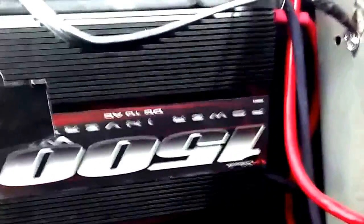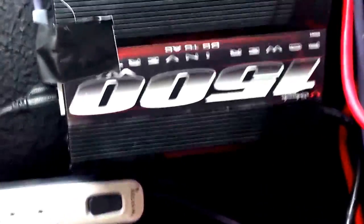So, you know, the vehicle is running. As soon as we disconnect that battery, this power inverter with the vehicle running will not run that air compressor. When it is connected, when we have that battery backup in there, we can run the air compressor, we can run the lights, and we can run the key machine all at the same time with no problems.